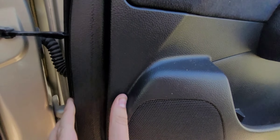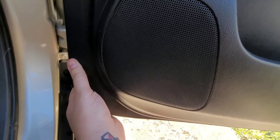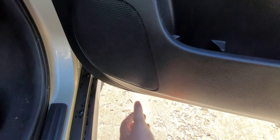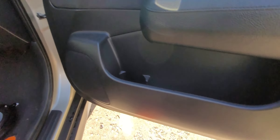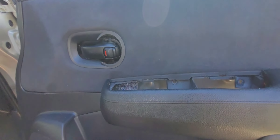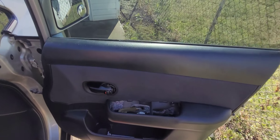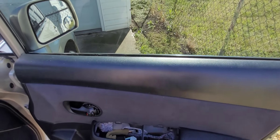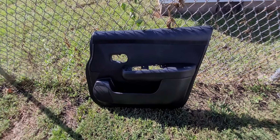Alongside the door there's going to be a nice panel gap that we can pull up on — just give it a tug. Work your way down; this one's a bit difficult. After you've worked your way around the door it should come free, which in this case it has. Now pull up here — have another hand over here if possible — and pull upwards. Door panel off.